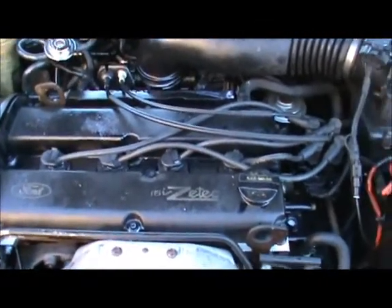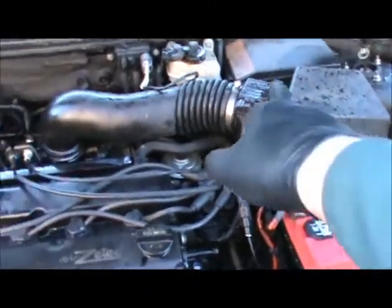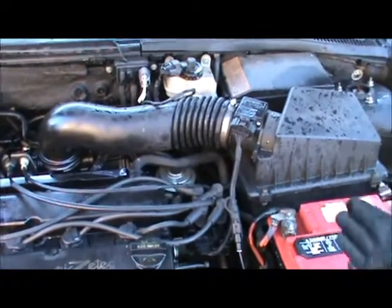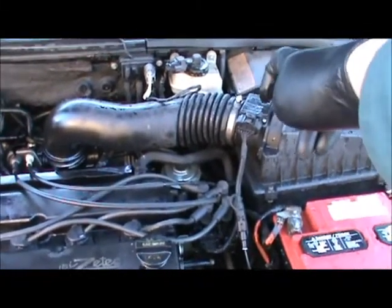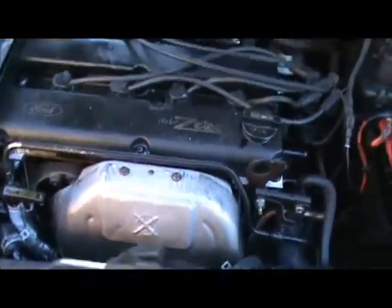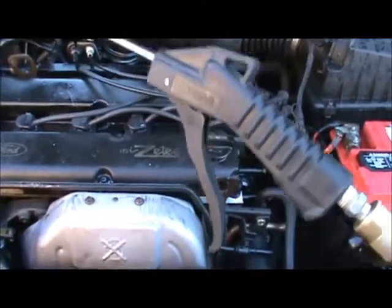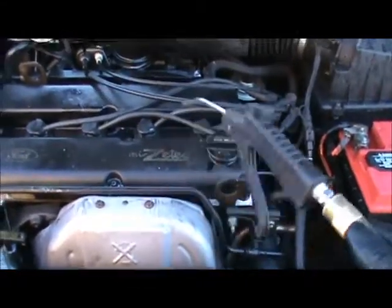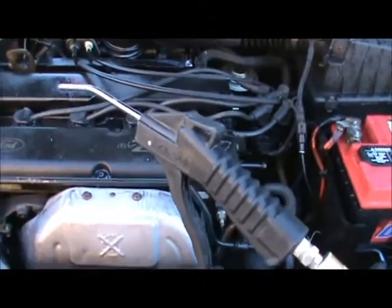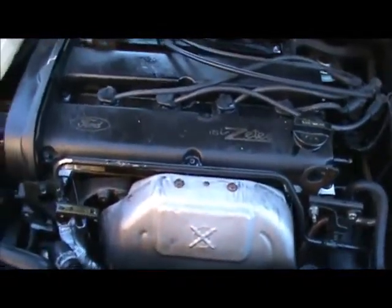Clean your engine. It's a little dangerous, but if you follow my procedure, you disconnect the negative battery cable. You make sure you don't get any water into the intake. You make sure you don't get any water into the engine computer if it's in the engine bay. Cover that up if you have to. Let it sit for a while. Honestly, I probably wouldn't even do it unless you're going to let the car sit for at least 2 days, unless you have air to blow it out. I think this is a necessity. But you could get one of these air compressors for $50 at Harbor Freight nowadays, you know.